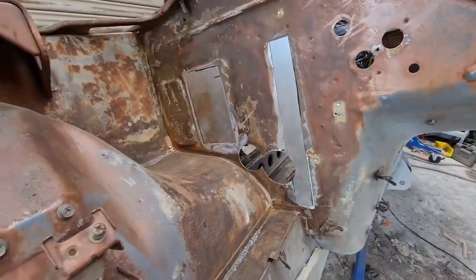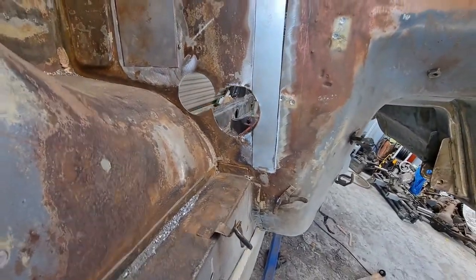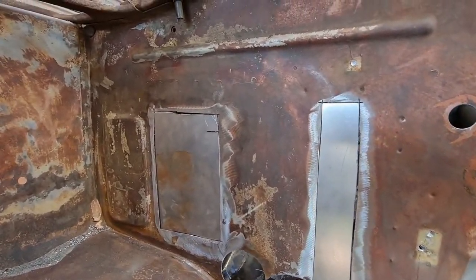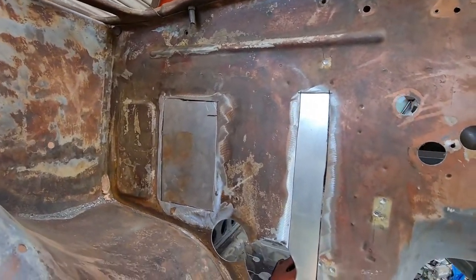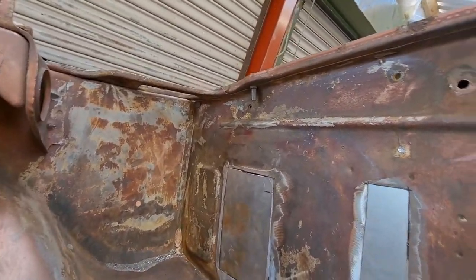If you like the detail I go into on projects like this, just give us a little subscribe and a like — I really appreciate that. I've managed to use the other two cutouts to cut the shape of these two plates. Now I'll have these welded in as a nice little flat plane for my pedal box plate to mate up against. I can tack these from this side and then weld them from the other side — that way I don't have to worry too much about grinding on this side. I'll give it a lash.